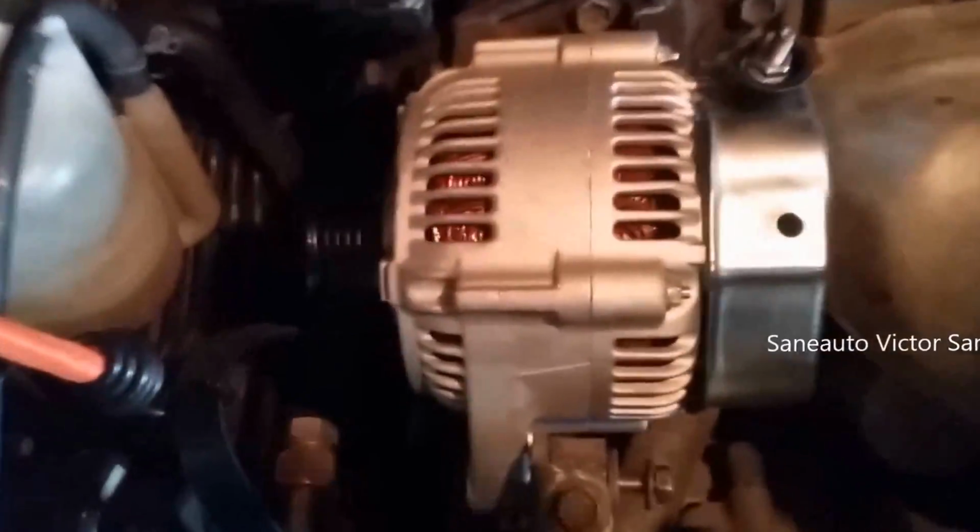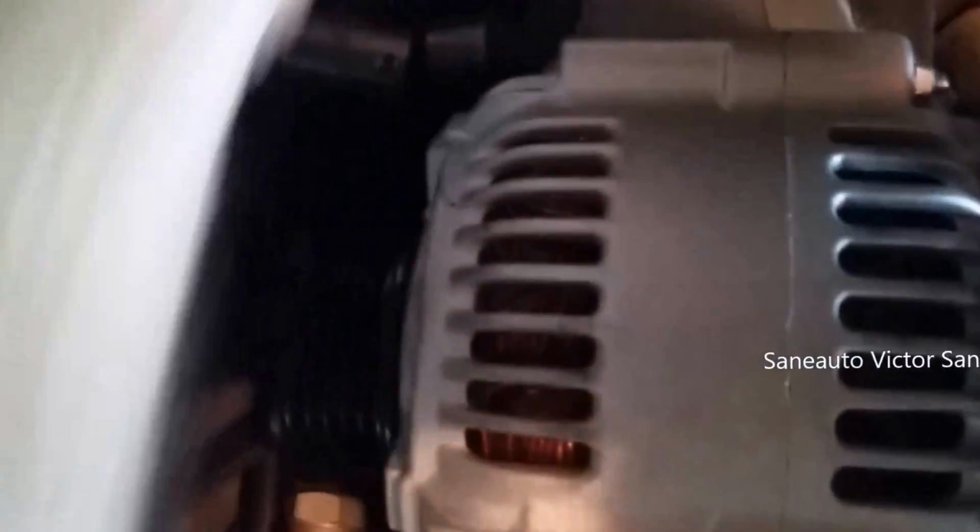Alright, so we've set the new alternator in place. Getting the bolts started takes 2 hands as well. And this one was, of course, the one I dropped and it's just simply laying underneath the car. Here, wait, here we go. Of course, we can run this down, but we can't put the final tightening on it until we do the adjusting of the belt. And the reason the belt hasn't fell is because of this bungee cord I used.